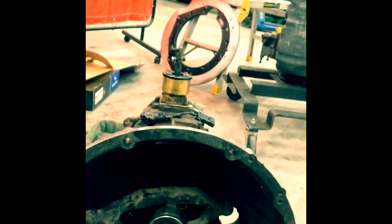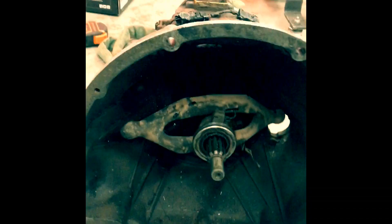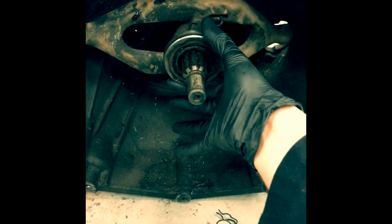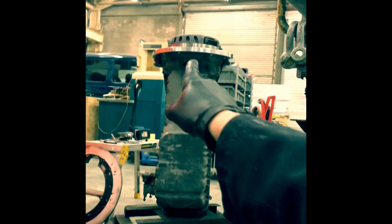It can be a little bit of trial and error. For a lot of the adapter kits that we already do, I can always give advice on how much to take it because I've probably done it before. To cut a long story short, get this bearing to around about 80mm — the same as the other — before you put these two items together. You don't want this to be less than 80mm, because if it's in a static position pushed out more than that, you're going to be putting pressure on your pressure plate, which will release that friction disc and wear out your bearing. So make sure it has that tiny little bit of free play — a millimetre's fine. And then go from there.